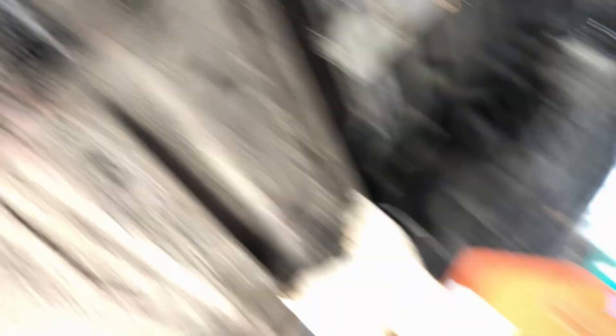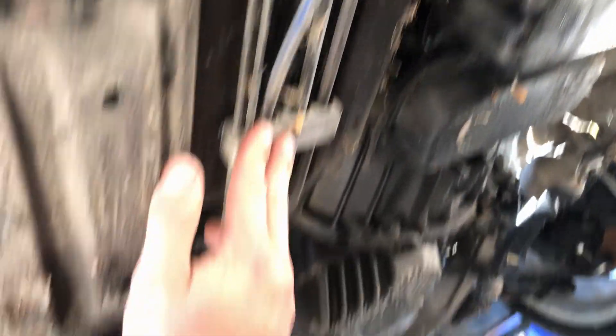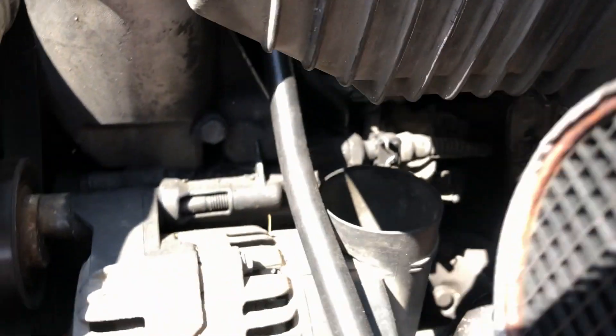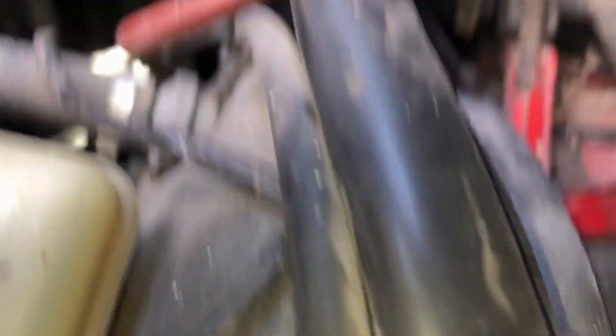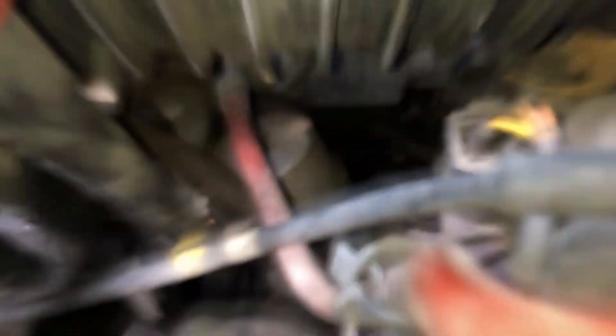Unfortunately we didn't quite luck out. There is a version of E36 where — maybe it's OBD2 — the fuel filter goes right along the hard lines, but on this one it's on the driver's side of the oil pan right by the steering shaft. It's going to be a pain to get to; I might consider taking off the intake manifold. Looking from the top — sure enough the filter is right down here. There it is by the starter — not a very easy spot.